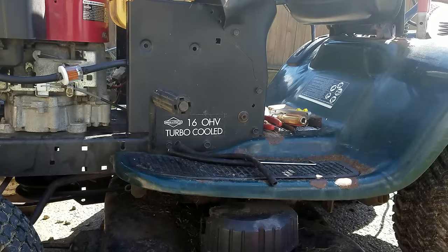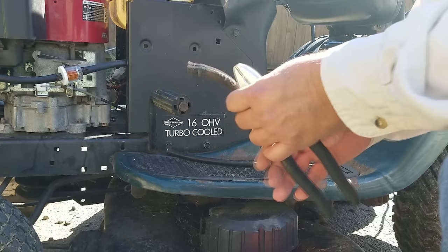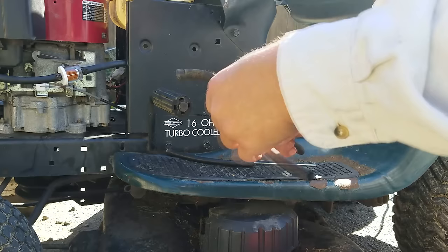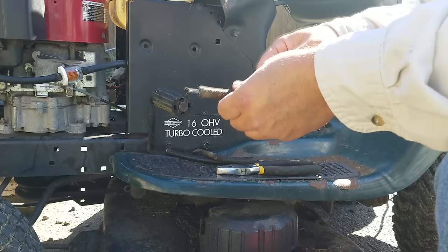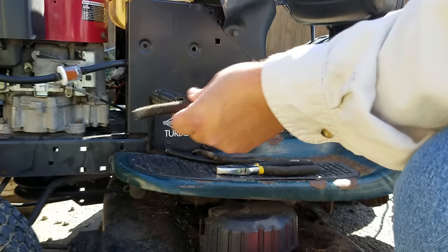We're going to tighten down the fuel tank. Just for the heck of it, let's see what that clogged fuel line actually looks like. I've got a little rod that I'm going to try to push the gunk out with — and yeah, you can see it. This is what ethanol fuel does to these fuel lines. Some of that may be a little dirt buildup, but I strain my gas before I put it in the tank — this is definitely bad fuel line. It just eats it alive.